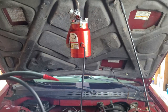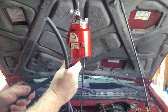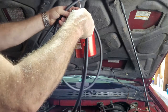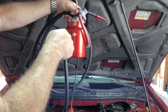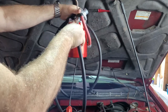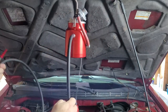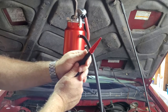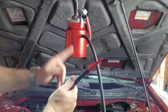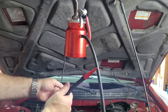While this is heating up I'm going to go ahead and connect the outlet hose — your smoke is actually going to come out here. This slides over the fitting on the side, and as you can see smoke is already starting to come out. Once that's in place, you need to find a good spot to actually induce the smoke into the vehicle, and I'm going to show you what I think is the best entry point for this type and probably for most vehicles as well.